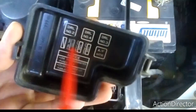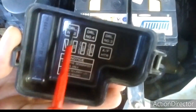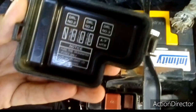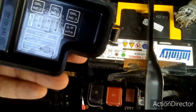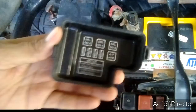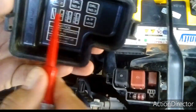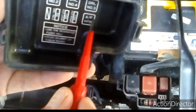DRL number two, DRL number four — DRL stands for daytime running lights. In American-spec Toyota Camry they provide this feature: as soon as you turn on the ignition switch your low beam light comes on and remains on until the engine remains on. These relays are responsible for all three DRL daytime running lights.